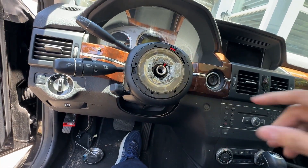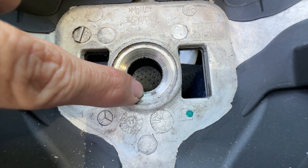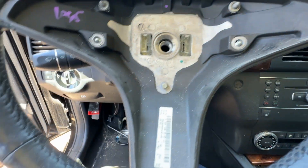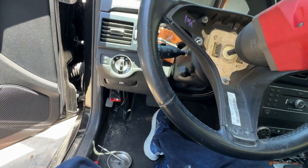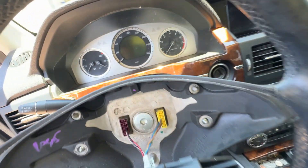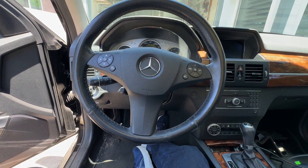Now we're going to put our steering wheel back on. Make sure that you line up the little Sharpie marks — you can see right there, that's the top one. There's one on the bottom too; line those up with your Sharpie marks. Let's put our bolt back in — start it by hand, finish it off with the impact. Next is the airbag — put the clips back in. Yellow is on the right side and maroon on the left. Looks like the Germans didn't know what to call it either — they put yellow on one side. The steering wheel is back on. Tighten the bolts in the back.